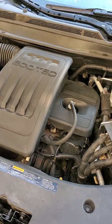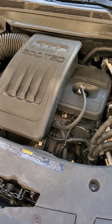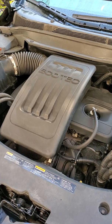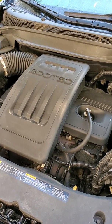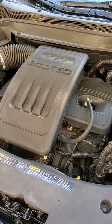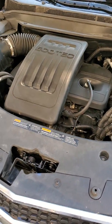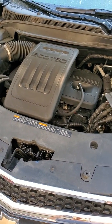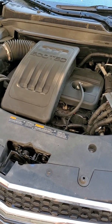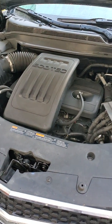Seriously, this is the easiest thing — you don't need to pull the manifold off, you can do this whole thing in an hour. This car has 124,000 miles on it and I've had this on here for a little over a year now — it's been flawless. But seriously, without the ring and piston update this is not going to help you a ton, because the problem is so bad you've got to have that ring update. I hope this helps — I'll put some part numbers in the description. If you have any questions, comment below. Thanks guys.